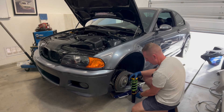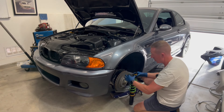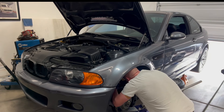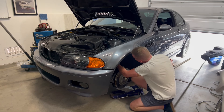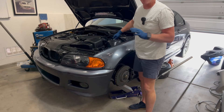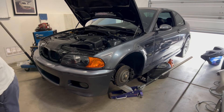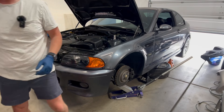Alright guys, we're just going to mock this up for now. I can put a lot of this back in the car and just let it sit until I'm ready — then all I need to do is pop this off and put the bump stop and the dust cover on. I could probably drive it but I don't think that's a good idea. I already bought a new 19mm nut so we won't reuse this particular one, but at least we'll have everything kind of buttoned up lightly.